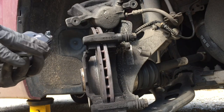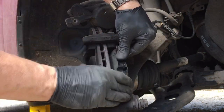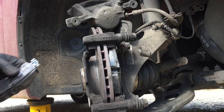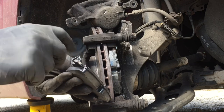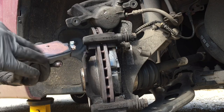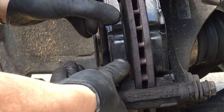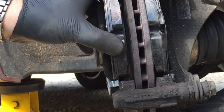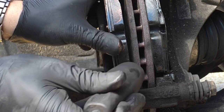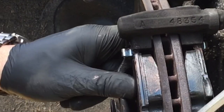When you're putting the new pads back in you've got to be ever so careful. The little spring clips on the end of the brake pads are really easy to bend. You have to push the back in first, compress the little spring, and then squeeze them in. That's probably what caused the problem on this car - the pad on the other side just hasn't been sliding as far as it should and it's worn down unevenly. Push it in backwards and then push it sideways and give it a little tap to get that clip in.